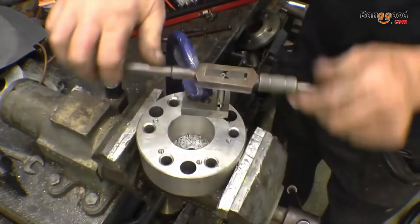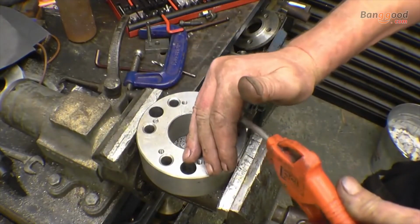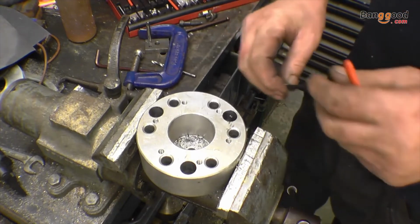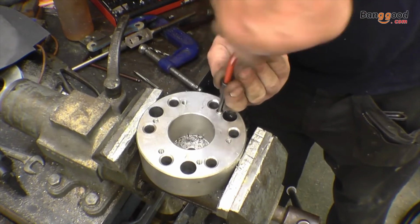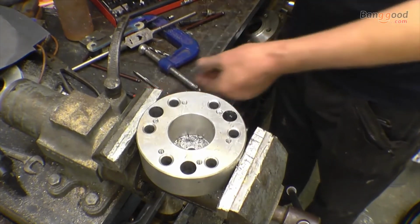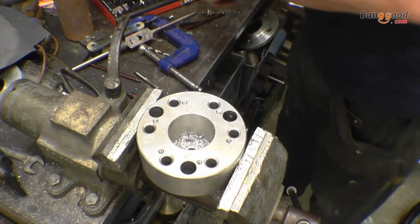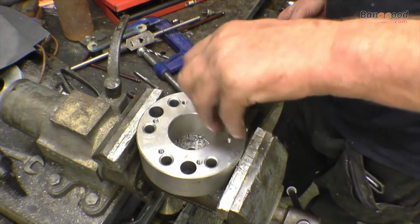This is a blind hole this time, so we'll have to be careful. And once again we'll get a full length insert into there. And half a thread below the surface. Knock the top off. And a little magnet to be able to lift that out of there. I haven't got a little magnet here, unfortunately. And so a 6mm bolt goes in there quite nicely.